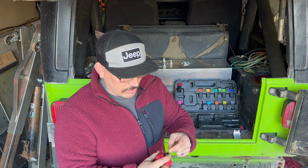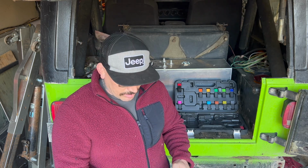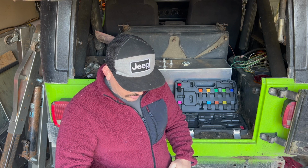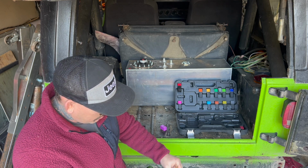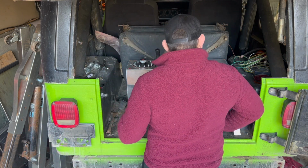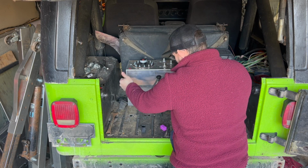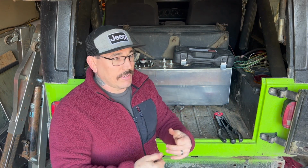These are just one of those tools that I've found myself using on everything. Body armor, fender flares, doing this, the skid plate bolts, like I said already. There's just a lot that you end up finding yourself needing it for. So it's pretty simple, put it together. From there, all we're really going to need to do is throw the nutsert on it, stick it down, pull it together. That's it. You're done. Way less hassle than fighting with two wrenches.